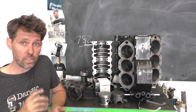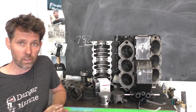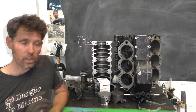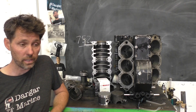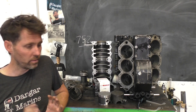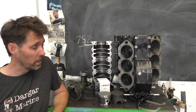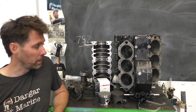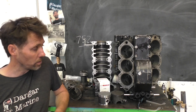I was also very fortunate to be lent the service manual for this outboard by Graham Hall from Brooklyn Yamaha - a really nice guy who very kindly lent me that so we can put this together with all the torque specs and clearances we need. I talked about clearances and ring gaps with Kelvin before I left, and he said it should actually be all ready to go. All the rings are pre-gapped and come as a set with the pistons - piston, rings, circlips, all in one package. He also said when assembling, just use two-stroke oil as your main pre-assembly lubricant for everything.